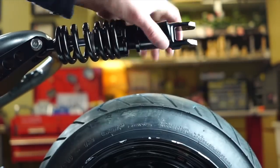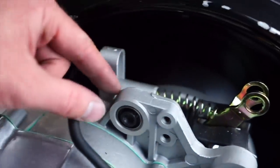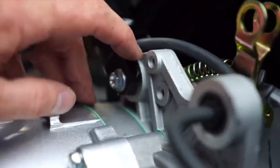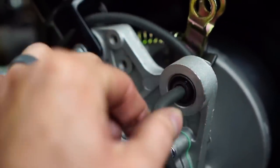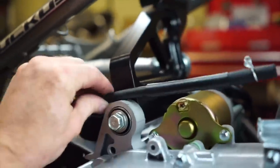The other thing I should mention — I've grinded that away just slightly because it will hit the engine case right when you mount it. So it's just a custom thing that you have to do so that you don't have anything making contact. Everything is spaced back here real nice. I've taken the breather hose for the transmission, kind of ran it through this hole and pointed it down. I've got the same thing going right here — I normally zip tie this above the air filter.